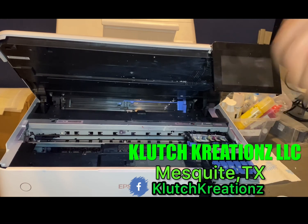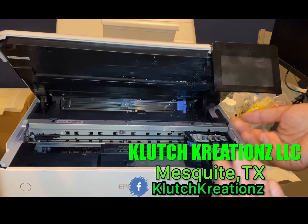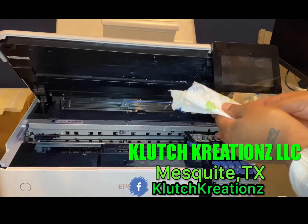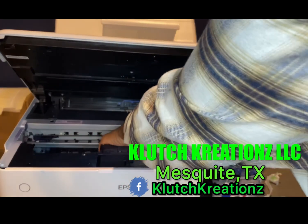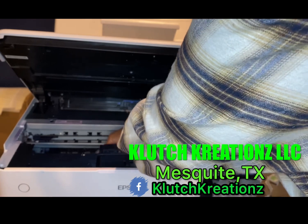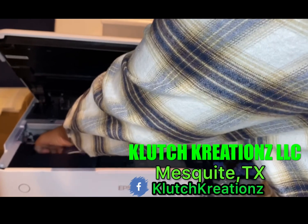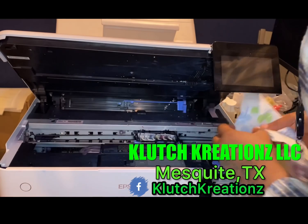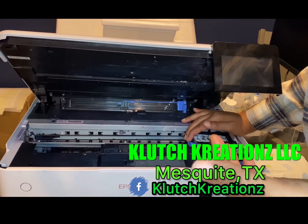You'll know if it's working — when you move it, you'll see all kind of ink on it. Another thing I do is I take that same napkin, fold it long ways, put water and cleaning solution on it, and lay it here. Then I take my printhead and drag it back and forth over the napkin, cleaning it this way. That gets any debris or residue that you have under there that may be causing scraping or giving you those ugly lines as well.